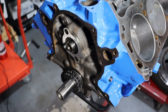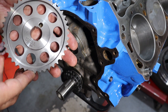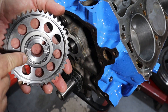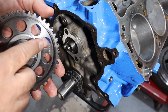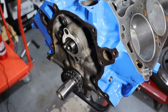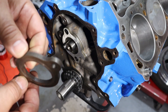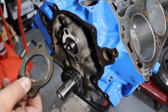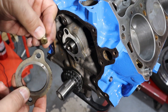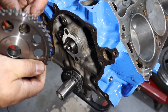I'm not using the Torrington bearing type retainer on this particular engine because my Comp Cams 7138 billet timing set already has a Torrington bearing on the backside of the cam gear — it comes installed when you get the kit. Most cam retainer plates, especially on stock engines and most aftermarket ones, are just a solid piece of steel with traditional fastener holes, held in place with a standard shallow hex head bolt so that when installed it doesn't protrude far and won't contact the cam gear.